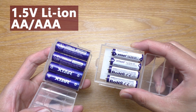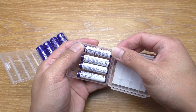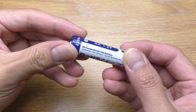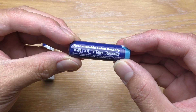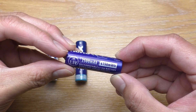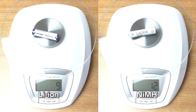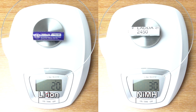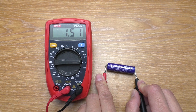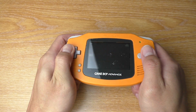They also sent me these 1.5V lithium-ion batteries to try out. So now we have 3 types of double and triple A rechargeable batteries: the usual 1.2V nickel metal hydride batteries, standard lithium-ion at 3.7V or 3.6V, and the new addition — lithium-ion batteries at 1.5V. Basically, it is lithium-ion but it has a controller inside to cap the output to 1.5V. The advantages are that it is much lighter than nickel metal hydride batteries and it supplies a constant 1.5V. You can use this with any appliances that use double A or triple A batteries — but should you?